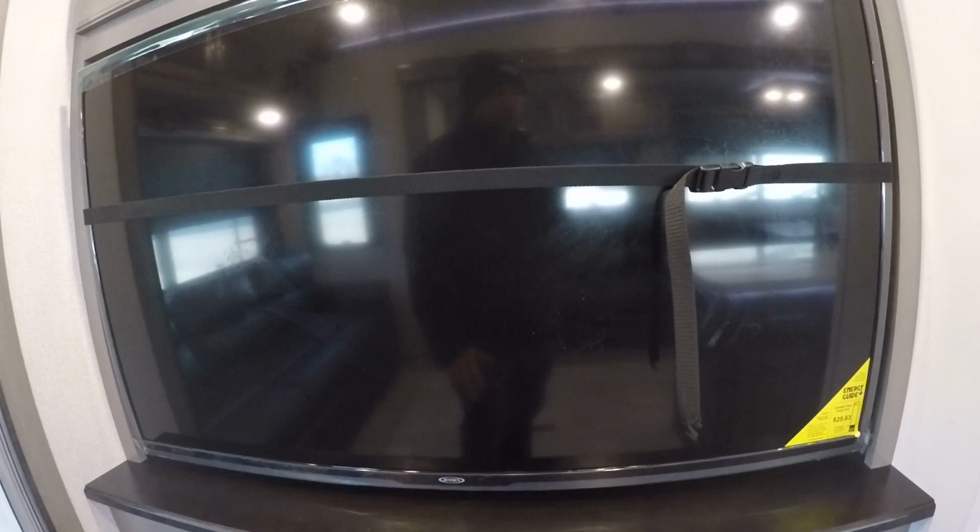To the left, you're gonna have your entertainment center, your TV, your radio, as well as your fireplace. Your bigger items like your TV and your fireplace are not gonna work without shore power, so just remember that. If you're running a 30 amp, you can't run everything, so your fireplace, microwave, TV. If you're gonna run your microwave, turn your fireplace off if you've got your TV on with your heat on. There are just things with 30 amp that you'll have to watch your usage.